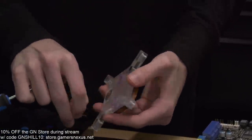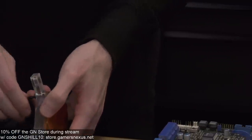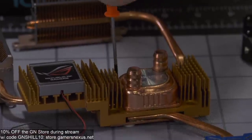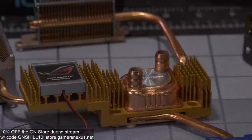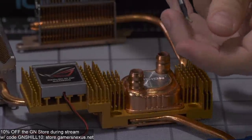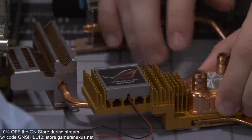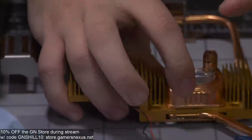It's almost like you weren't ever supposed to take it apart. Yeah. Do we know, is this officially part of the motherboard, this block? Yeah. Okay. They sold it with it. I'm not sure if you necessarily had to use liquid cooling with it. In the manual, they said that if you used liquid cooling on the CPU, there are fans, like squirrel cage fans, that they sold, or maybe they came with the board, that would clip onto these heat sinks here. Okay. So just blower fans that would blow straight down into those heat sinks. Gotcha. Well, the screw's out.